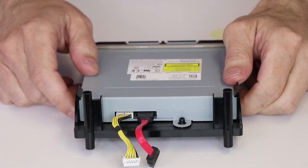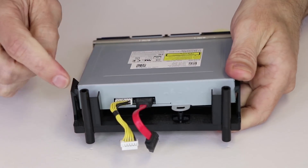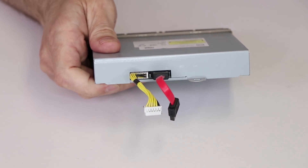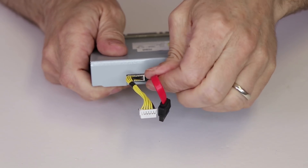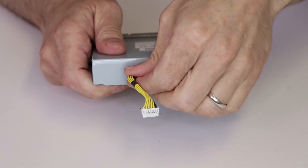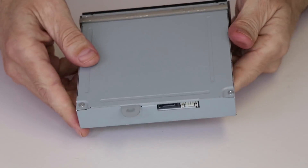With all that being said, let's get into the repair. Once you have your disk drive removed from your Xbox, you'll need to remove this bracket. These clips just hold it onto the disk drive itself. We'll remove that and then we'll need to remove these two cables from the back. Just grab them and pull — wiggle them back and forth just to make sure they come out.